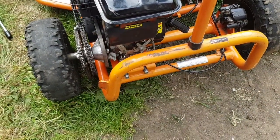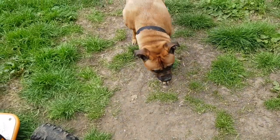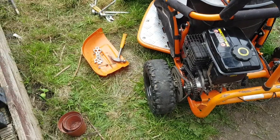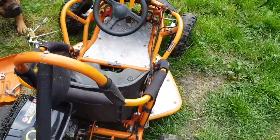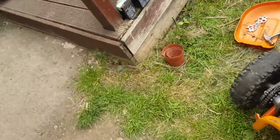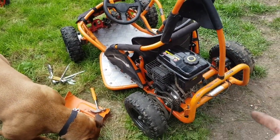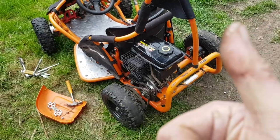Okay, let's get the kill switch put on — I was pulling for ages for no reason. Right, are you ready for the unveiling? Oh, look at that — ticking away lovely! Not even trying to pull away by itself. I just killed it because the choke's not fully on yet. Excellent — so chain's good. As you can see we've still got a little bit of wobble in there, maybe too much. I might slacken the bolts off, tighten up the chain tension a little bit, and put the bolts down again. Let's get the orange case back on and job's a good one.